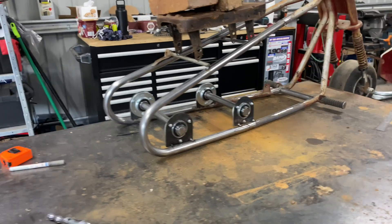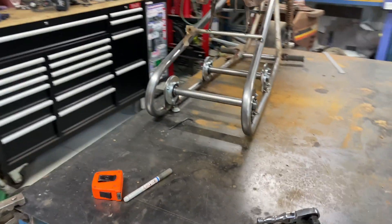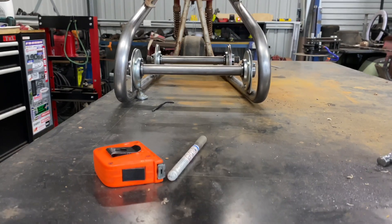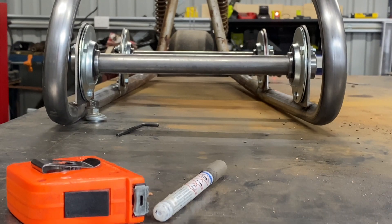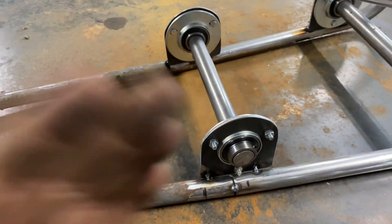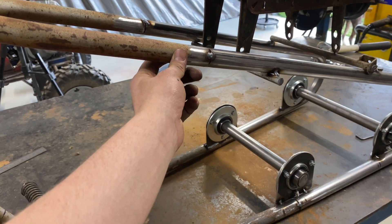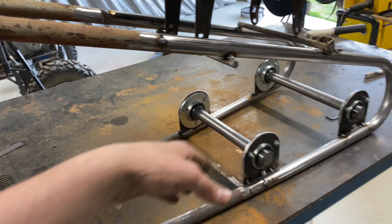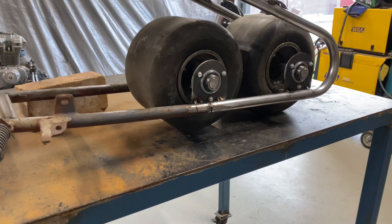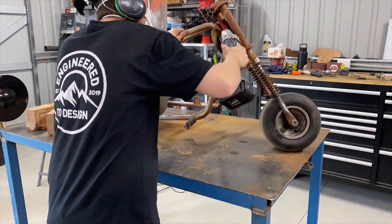Decided to take the wheels off and sit down on the bench. This original frame is actually quite bent, and when we've added onto it, it's thrown out a little bit. I've made it as best I can — it's super difficult because this thing just tapers off. Got it height-wise set up, it's perfect. They both level out, so as long as those run true to each other and to the bike, we should be okay. The flange placement — if they're tilted a little bit I can't do much about that because the frame is tilting off on an angle anyway. We've got both wheels back on and tacked. Next issue: the rear wheel is contacting the table but the front's not. We're going to have to rake the front out a little bit, which it needs anyway because it's sitting up too much.